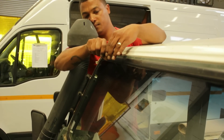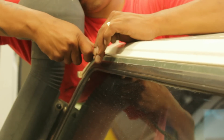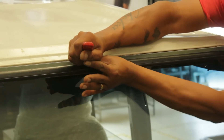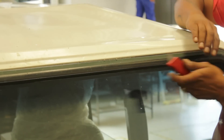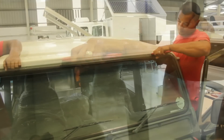You will then need to cut the glue line that joins the windscreen frame to the roof. Apply caution when doing so — it's a thick, strong layer of glue that bonds the roof to the windscreen frame. We use a carpet knife, or a Stanley knife as they call it. Just be careful not to cut the paint off the windscreen frame.